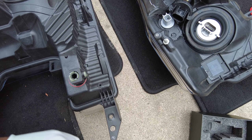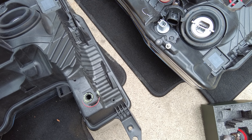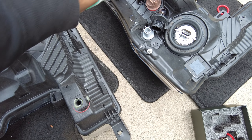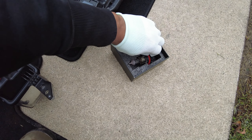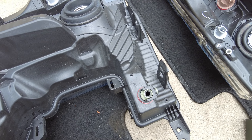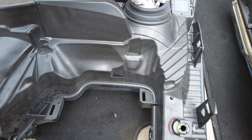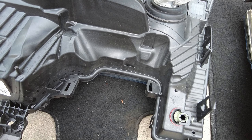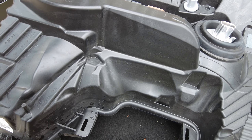What was going on is these red gaskets belong to the other headlight bulbs and they're just stuck there — that's why I was having a hard time. These actually belong to those other lights and it's making things difficult. On the one light that did work, the red gasket came off. So the red gaskets stay on the headlight and sometimes they don't — that threw me off. Getting it in the hole, making sure the yellow gasket is there, turn it — no problems, turns right in.